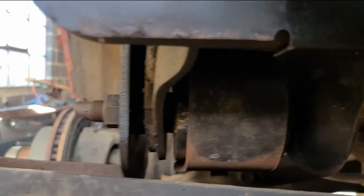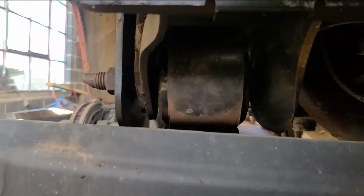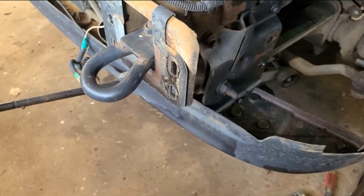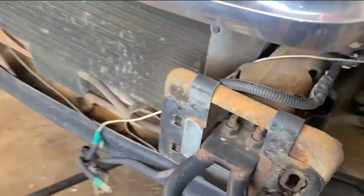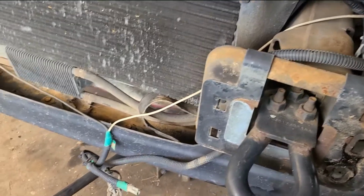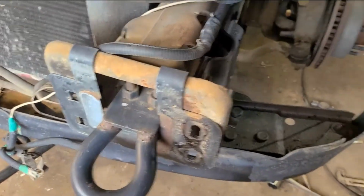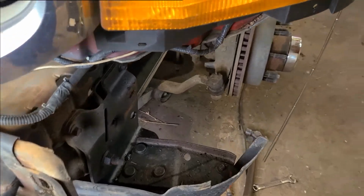Same thing on this one. I'll just cut either side of them right down through the bolt. Looks like I got pretty good access for a Sawzall there. So we'll cut them off, and that way I don't have to deal with the radiator. And when we go ahead and put the new bolts in, they're going to go nut to the inside. So if I ever, for any reason that I can't imagine right now, would want to take them off, that becomes feasible. Alright, so I'm going to get at it with the drive shaft next.